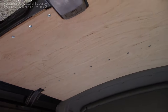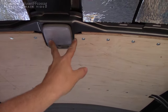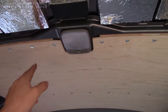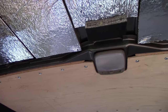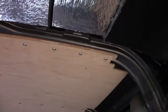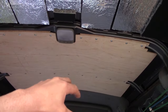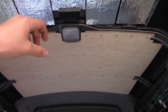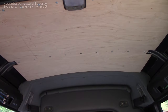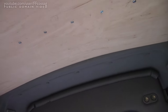Something I found was very important: when it's a bit curved like this, it's very important to start in the middle, do about three screws there, and then step out one at a time. Because the holes will otherwise shift if you pre-drill them, and that's not going to work out well at all. I also had to emergency-add some soundproofing here and there's actually some extra underneath that, because when I first test-mounted it without anything coupling it through to the roof, it sounded very hollow and resonant, which would make a lot of noise while driving. But now I've got some thicker pads which actually make contact with the wood, and that's going to do excellent.